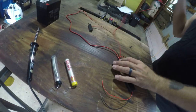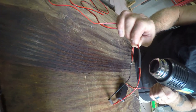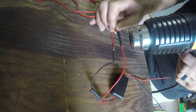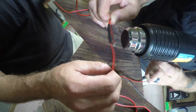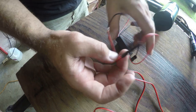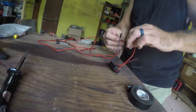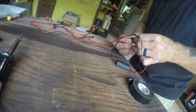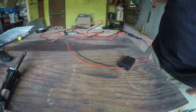These might not be all that long so I'm gonna leave these the length they are. Here's the fun with the shrink tubing — see how wide that is? See how it starts shrinking up. That didn't completely tighten up around this wire because it's a smaller diameter than the shrinking ability of this, so what we'll do is electrical tape it. I'll just wrap a little bit of electrical tape around each end as well — just for redundancy. And if any moisture gets in there, it's probably underwater.